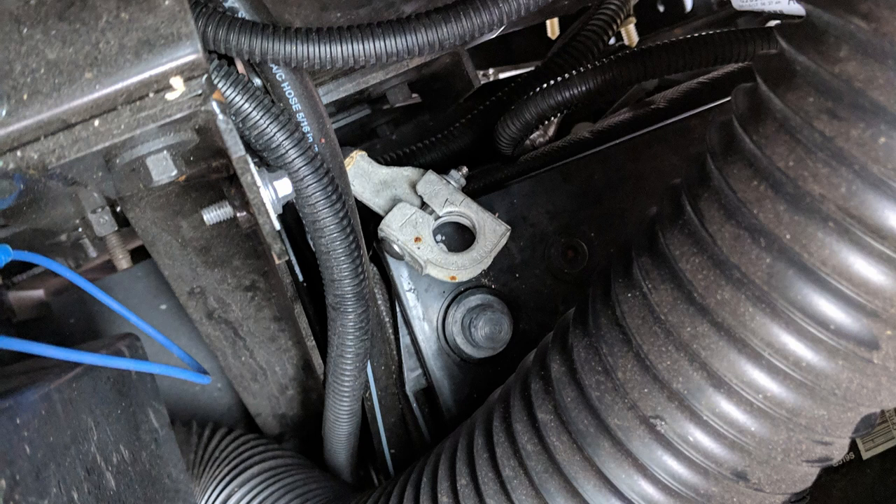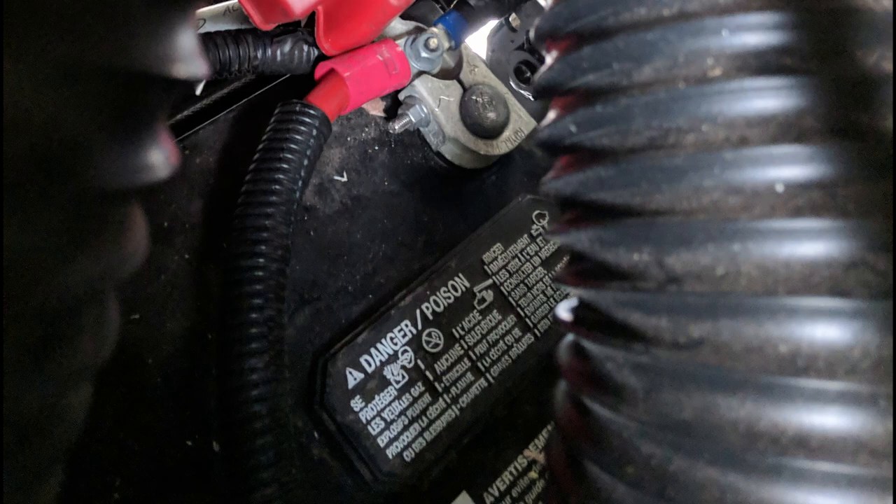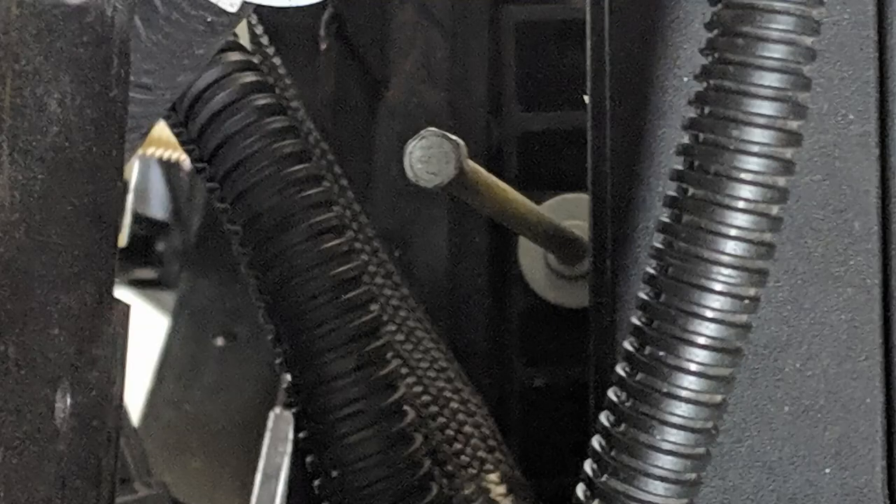So the next day I removed the old battery, which required me to detach the air vents that covered where the battery sits. That was easy — you open the access hood and they're attached above the radiator with hose clamps, so it just takes a screwdriver to detach that end. Then back inside you can move them out of the way. Then you detach both battery terminals.